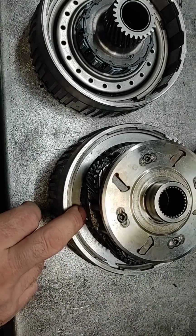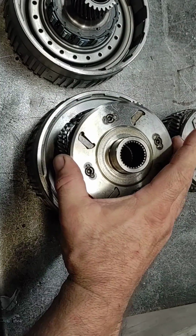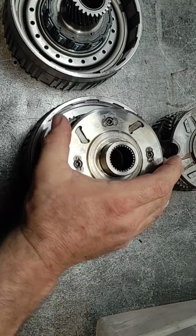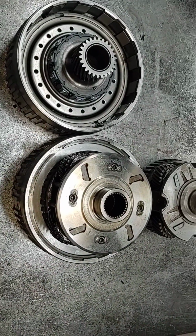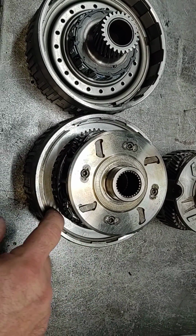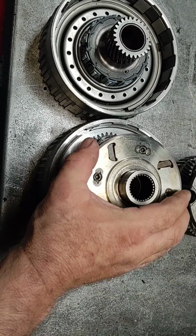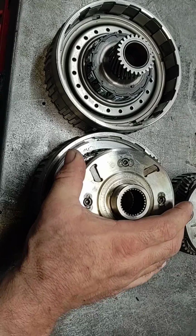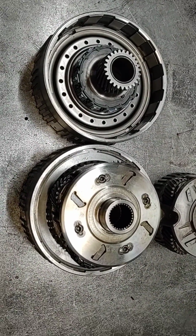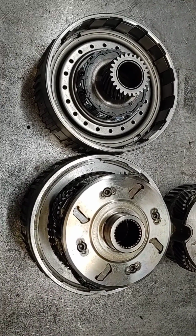So we're going to lock this in. It went into the overrun clutches, coasting clutches. As you can see, that rotates one way, and when it tries to rotate in engine rotation, it's locked. That's because this roller clutch here, the overdrive roller clutch, is holding all the power. When you manually shift the transmission out of overdrive into first, second, or third, these little clutches come on. There's only 3 of them. They're pretty small, limited capacity, but they keep this thing from overrunning and then locking back when you pedal the car. And so that helps everything live better. And just the fact those clutches are on lends a little capacity to that smallish overdrive roller clutch.